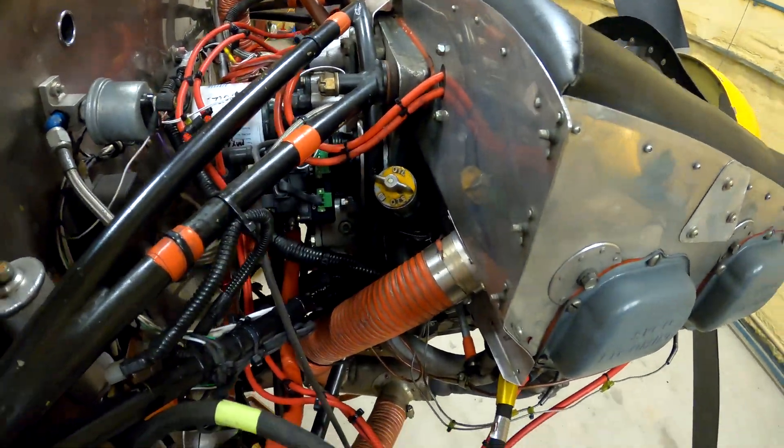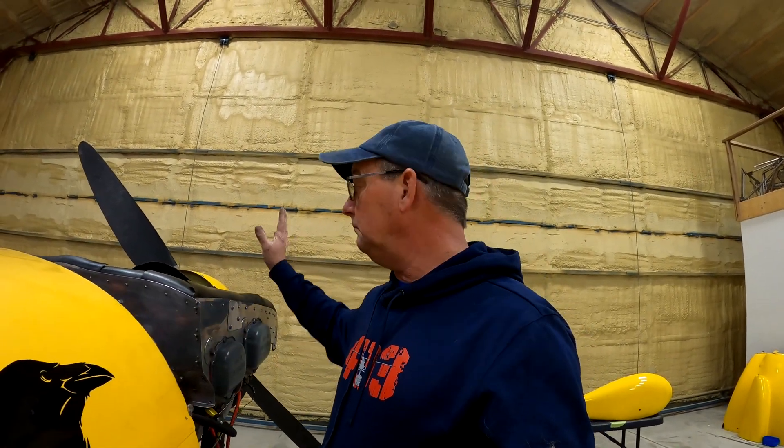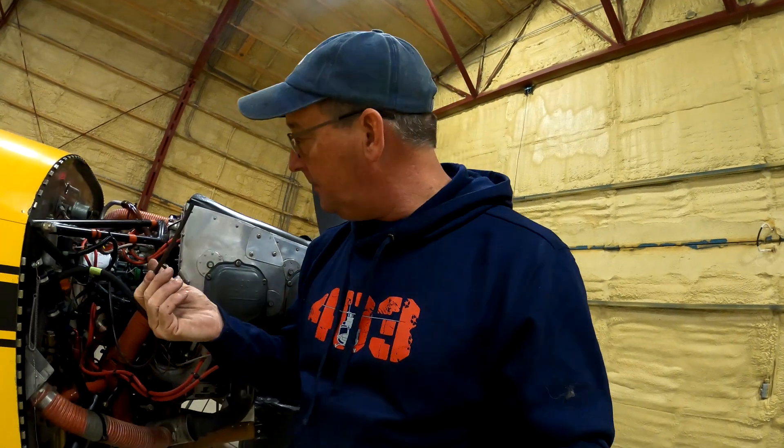Timing on that couldn't be easier. So with this e-mag it's pretty straightforward, actually. You just mount the mag in whichever way it fits nice, basically clamp it down, and then set the number one to top dead center. They have a manifold pressure line there — basically it's a little vacuum line — and you blow into it, you turn the power all on, you blow into it a couple of times, bing, you get a green light, you're timed. It don't get no easier than that — that's pretty nice.